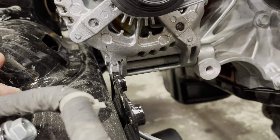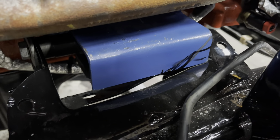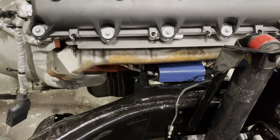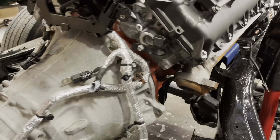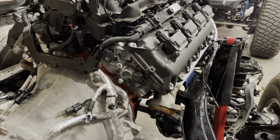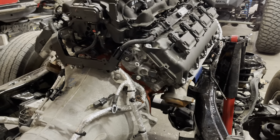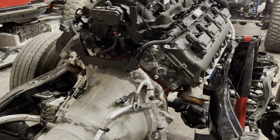This engine is down because we're still working on the transmission mount, and we also have to cut our front mount — something like that — because we have to move this engine all the way forward. With our bolt-in mounts, we had to run truck manifolds; we couldn't run the manifolds from the JL because they're too big. JLs run manifolds, not headers like everything else.